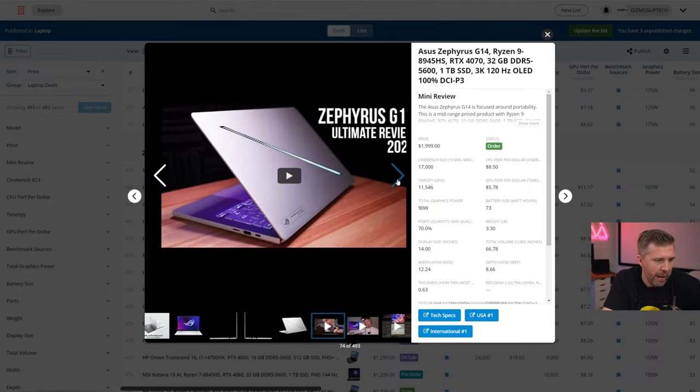All right, so overall power draw, we're looking currently at 81 watts almost exactly. So that's our peak power limit on the Zephyrus G14. Power draw over here on the Omen, 65 watts, 17,100 that time with the Omen 14. Let's see, our peak max watts, 81 right now, 82 for our max that we've had during our whole testing. 74 because we're thermal throttling, so we would be at 80 watts, but it's dropping down because of the thermal throttling on the Omen right now.